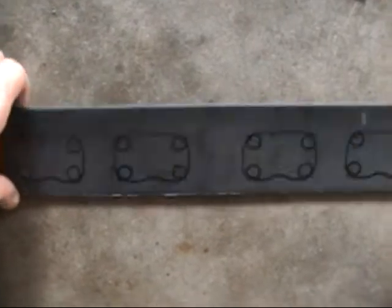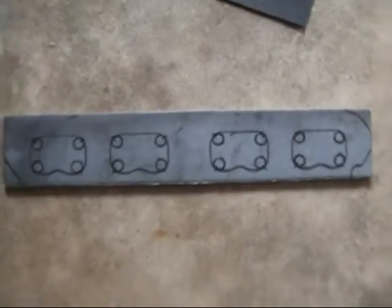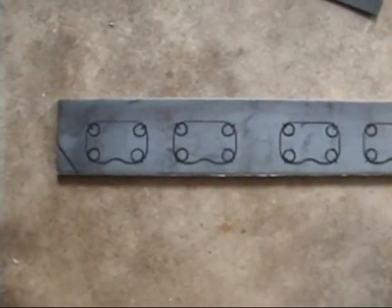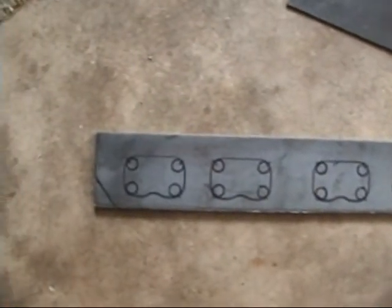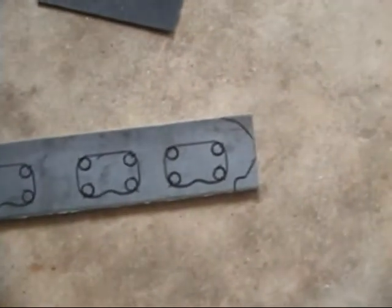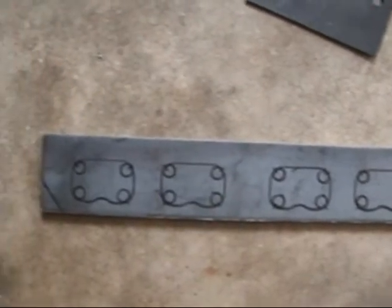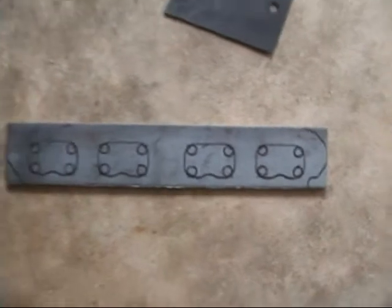I'm in the process of building the intake mounting plate and figuring out my intake runners. I make the mount plate here that mounts to the intake. I'm trying to remove this material the best I can without heating this piece of metal up too much. I'm going to drill these holes out, then take my cutting wheel and slowly cut that out, then use probably a hand grinder to clean it all up on the inside.